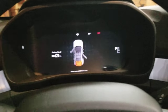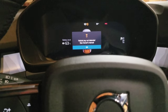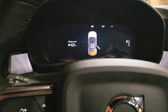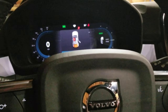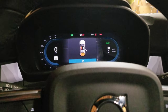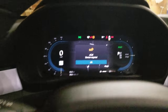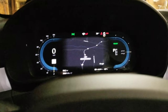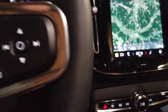I go to put it in reverse — here we go: 'Vehicle key not detected.' I put it in the little slot right here; this will let you drive. Press OK and you'll get this SOS message that just popped up. If you put it in drive, you'll see 'SOS call required' and your GPS is stuck. Your car is pretty well disabled at this point unless you put the key in the little cubby.